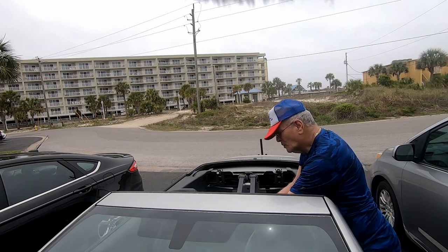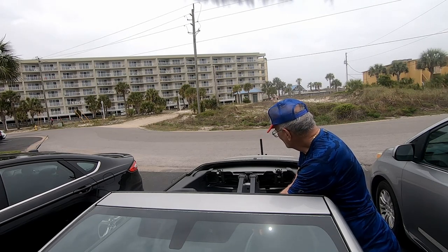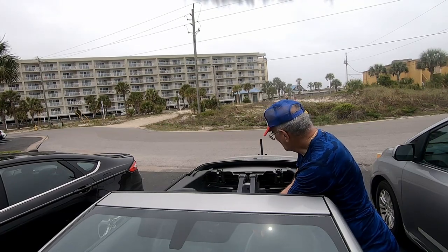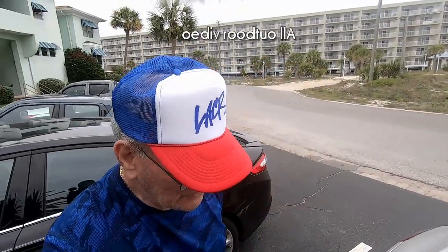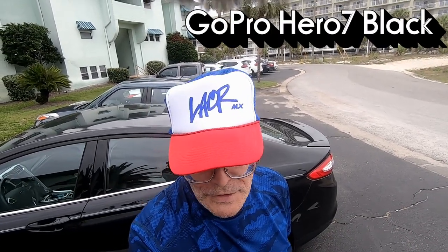Well, that didn't work. It ran for a while and then stopped. I can hear the motor running — maybe it's just trying to pump up the fluid because everything was empty — but it runs for a little bit and then quits. So far no good. Turns out the trunk lid never moved. At least I can still get it open, but that hasn't fixed anything. The motor makes sounds, I hear it running, but the trunk doesn't unlatch to try to raise the top at all. At least now you know how to fill up the reservoir from the trunk if you ever have to do that.